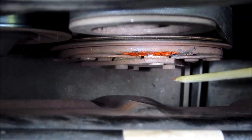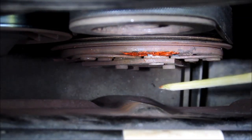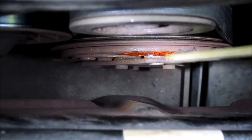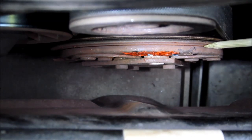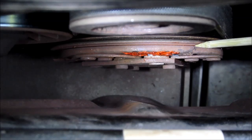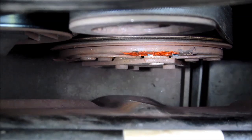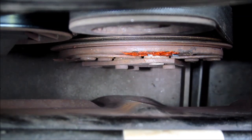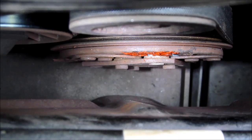We finished the fix by applying some of this orange-red high-temp gasket maker, which serves as a flexible, temperature-resistant adhesive to better hold the clip in. Now you can see there's just the tiniest gap right there — that's all it needs to disengage — and it only has that far to travel when it needs to engage. So that should have revived the aircon.